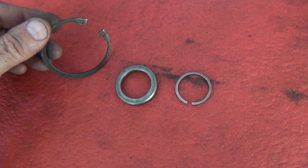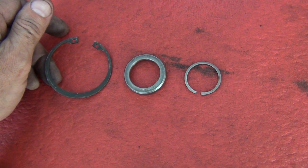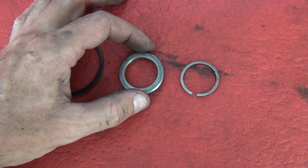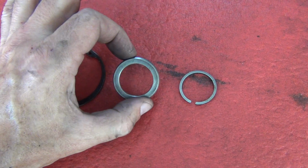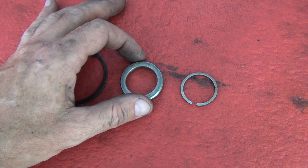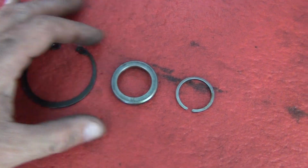Remember an earlier video you may have seen, my bottom drive gear had been touching the case on the inside, the transfer case cover, and it's pretty much ruined that gear. So I'm going to source another gear. The gear isn't absolutely catastrophic yet, but I certainly wouldn't do hundreds of Ks on it now knowing, because that would just be nail biting driving.